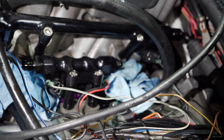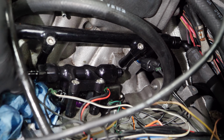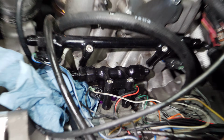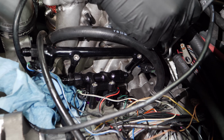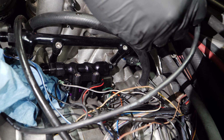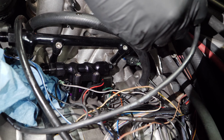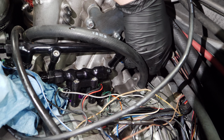One thing I did that I'm very happy about is tested the idea that an RX-7 could run on a returnless fuel system. That's what we've proven with this, that it's not an RX-7, but it's basically an RX-7. Now a rotary actually does a pretty decent job, not going into boost heavy. We did go into 15 pounds of boost, yeah, but you start running into the fuel injectors being less efficient, but we did it. And we're not gonna do it again.